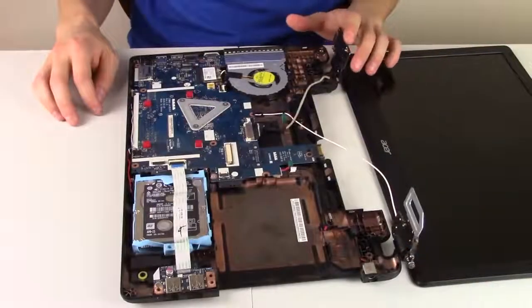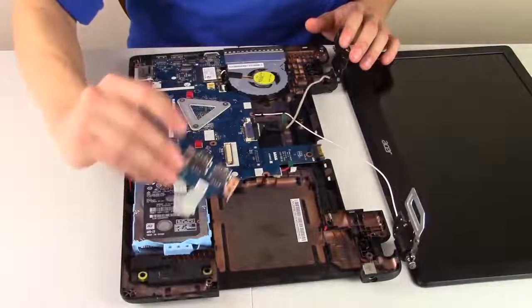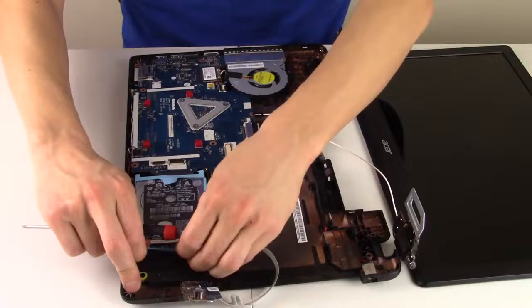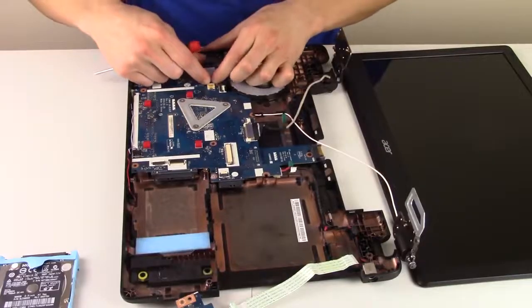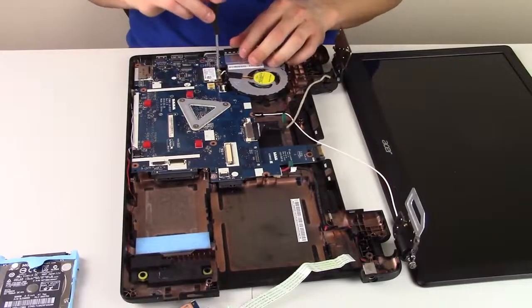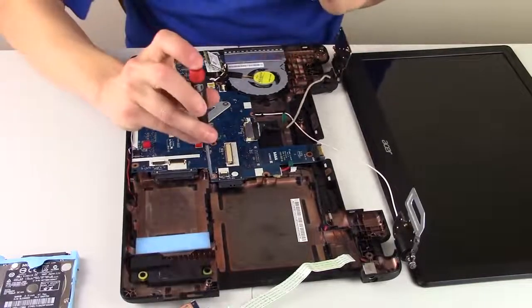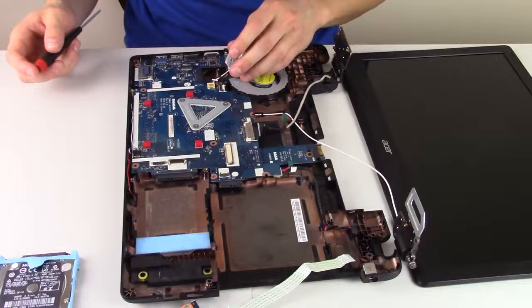So this is our motherboard. As you can see, there's no CMOS battery — that's because unfortunately it's on the underneath. So let's start taking this motherboard off so we can get under there. Undo this ribbon cable as well, move that over, hard drive over here. The Wi-Fi card needs to be removed as well. Some computers have a nice little access panel on the bottom where you can get your CMOS battery — if you have that, you are fortunate.